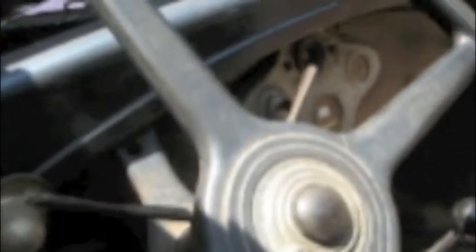Alright, so now we're going to take off the instrument panel so we can get at the harness at the back. So here we have A14401B. It's the instrument panel wiring harness, and we're going to stick that in the place. There's another reason we're rewiring the car. You can see some loose old tape here. A little bit of bare wire right there, which could easily have shorted out to the body of the car. And then the gas tank is right there, so really kind of dangerous. So we're glad that that's ready to be rewired.